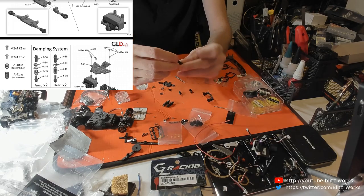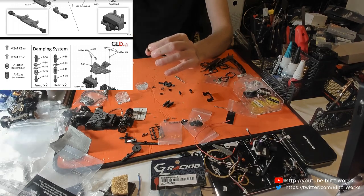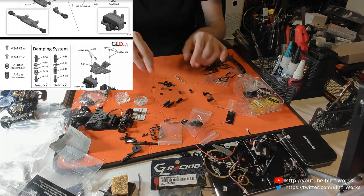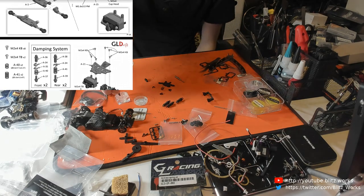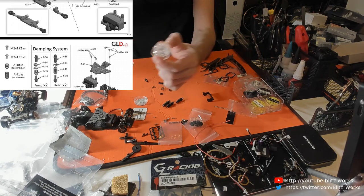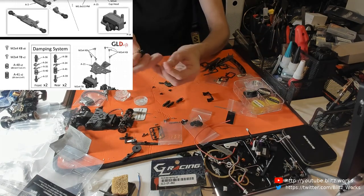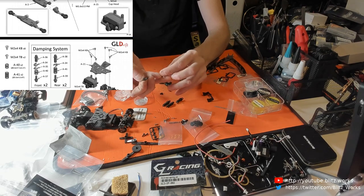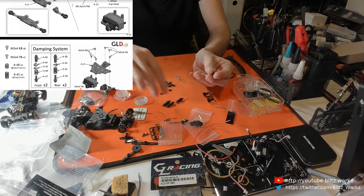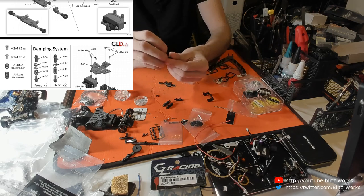Okay so we have a shock. The front shocks actually have more spacers and therefore more travel. Unfortunately the preload is not adjustable from the amount of travel on these greased spring setups, but it's not normally much of a problem. Normally you're only dealing with about half a millimeter difference in spring travel, but with this particular setup and the spacers you're looking at more like two to three mil — so I guess they wanted more travel in the front for drifting.